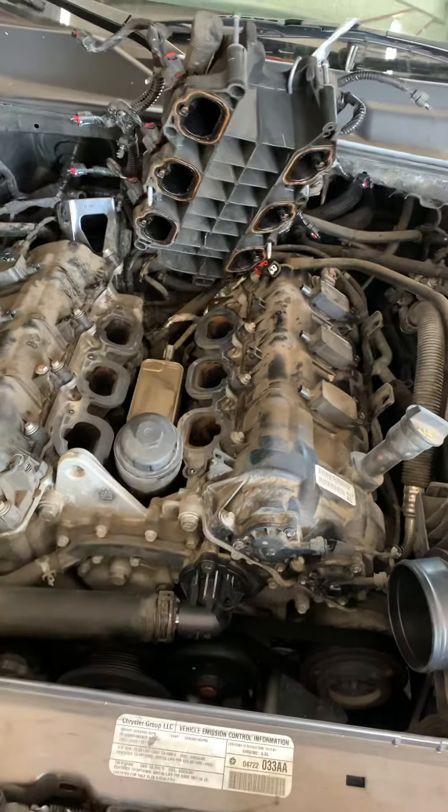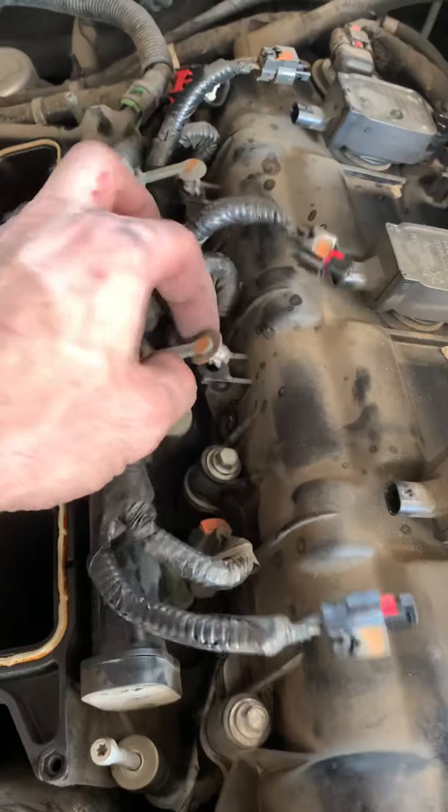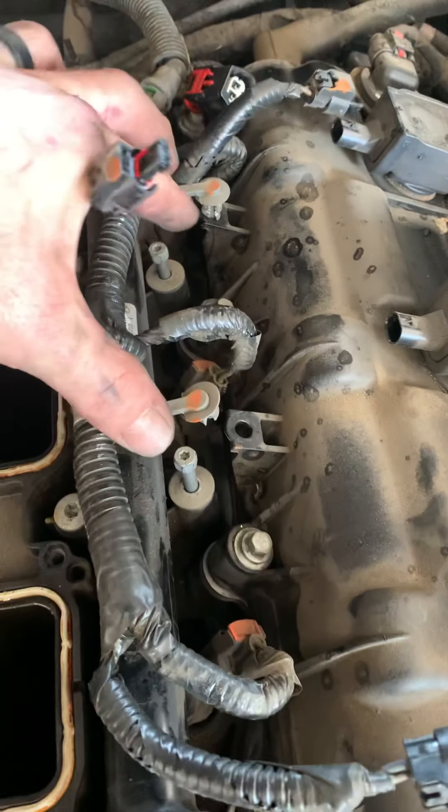When you're doing the intake, you unplug the connectors and the hoses where they connect. This lower intake is super easy — you don't have to disconnect the fuel system, you don't have to disconnect the fuel line. All you have to do is disconnect the coils, because the wires are plugged into the injectors and can stay with the fuel rail. You pull these plastic wire retainer clips off the valve cover so the wire can move. Just pull the connectors and the little wire clips — this one broke, this one's still good.